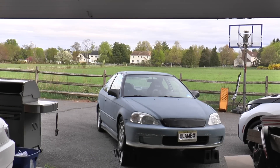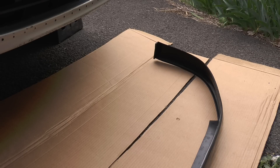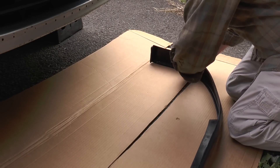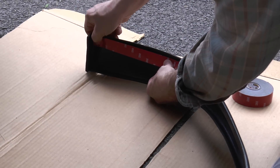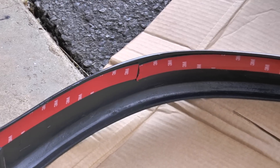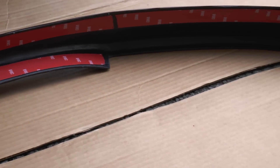There she is, just not gleaming in the sun. The first thing we'll do is promote some adhesion with 3M brand adhesion promoter. The instructions recommend using a number of smaller pieces of tape rather than one long strip along the entire length of the lip, so just cut it into smaller pieces — about 10 inches, less than 12. Here's a nice pan around of the entire lip. I've got it applied on the face and the bottom, so we're sticking on from two different sides. Fingers crossed it holds on.